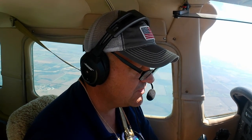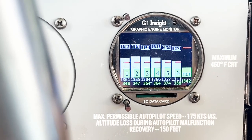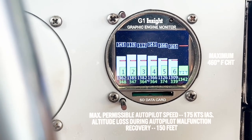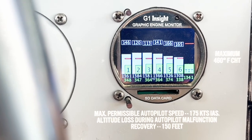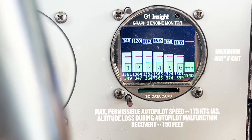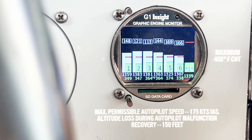2140 RPM — that should put my hottest cylinder somewhere in the 370s. Number five at 374, normally my hottest cylinder. From here I'll just fine-tune it. I'm a little bit rich — about 13 degrees rich right now. I'll probably let that stabilize for about five minutes, and if I need to ease it back, I'll just ease it back just a little bit to make small adjustments.